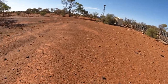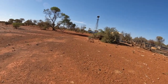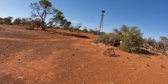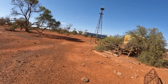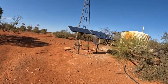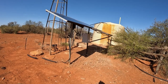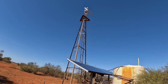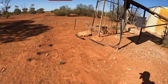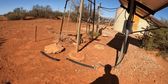Why we are here today and putting this little unit in is to increase the Wi-Fi range so that you can fly over and check in, which is just handy and nice to do. The box down here with the Wi-Fi in it at the moment is all metal, so it doesn't have the best transmission range — you've gone and thrown it in a metal cage so she's not going to perform well. Going to climb up there, put this unit in, and then take the old one out of the box.